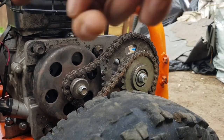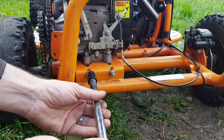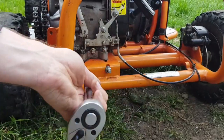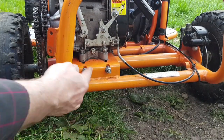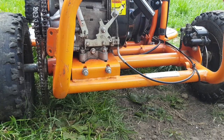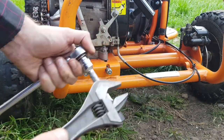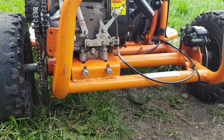Let's get this bolt slackened off and get all the bolts around the bottom of the engine slackened off. For these back ones here, it's just as simple as slacking them off — or if you've got them high off the ground you'll get a good spin. Just release these to the end of the bar. Once you get the nut to the end of the bolt, that'll be enough room for wiggling. Do that to both bolts. Now to get the bolts underneath at the bottom of the engine, I use a short extension for the bottom, and because there's no space to get a socket up here at these bolts, we use a shifting spanner.